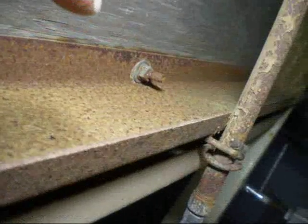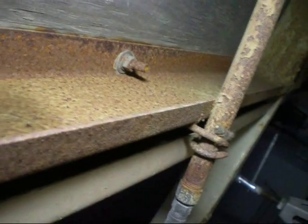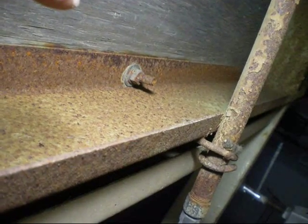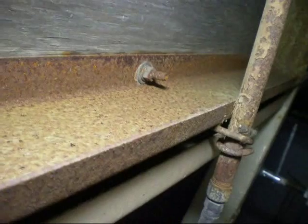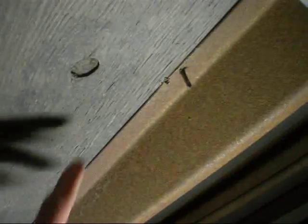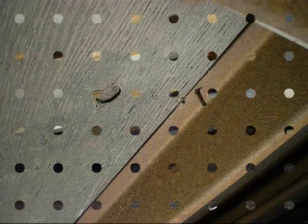What I'm going to do is take one of the bigger bolts — like this one here that goes right down through the body — flip it around the other way, make sure it's got good contact on the trailer frame, grind all this down, put dielectric grease on it, and point the bolt going up the other way so I have a ground point inside the trailer instead of running a wire up. You can see right here those are the sheet metal screws coming through the trailer floor, drilling into this thin metal — probably ten or twelve of them.